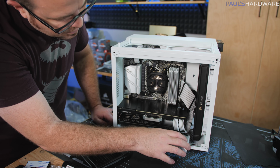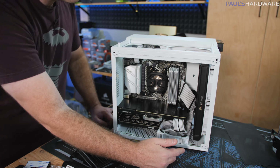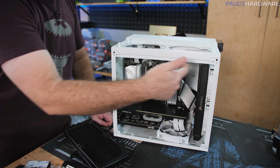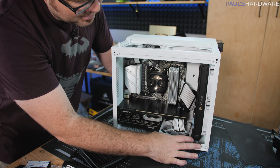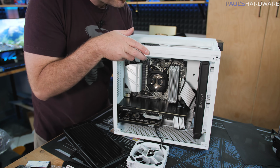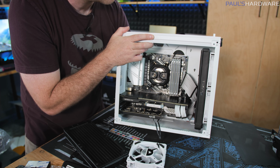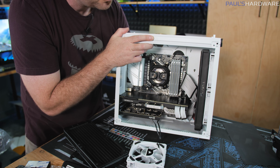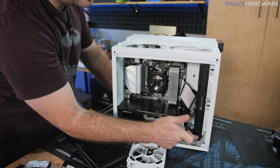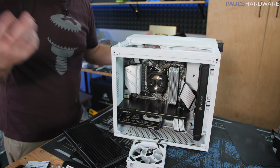The front one here, there is enough space right in front of that capture card, but then we run into conflicts with the front radiator, and I already mentioned in the first video why the connection points for the tubing need to be at the bottom for the front radiator, because if they're at the top, they would conflict with the top radiator. So with this fan here, there's really not much space for the tubing to come out. I also need to pass the tubing back through this single gap back here, which is where the tubing going back to the pump res is going to have to go, as well as coming back out the front for the rest of the loop. So I need to leave some space there. However, with this radiator flipped forward, now I'm thinking, could I somehow come around the corner here and still give myself a bit of extra space? I'm not sure, but let's give it a shot.